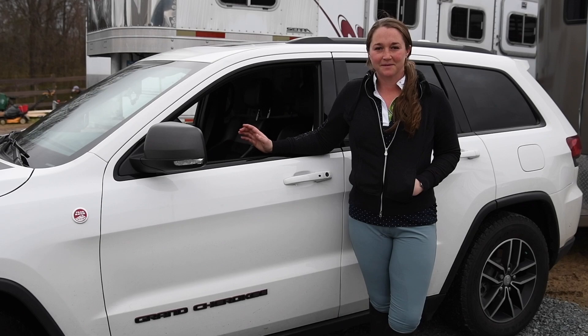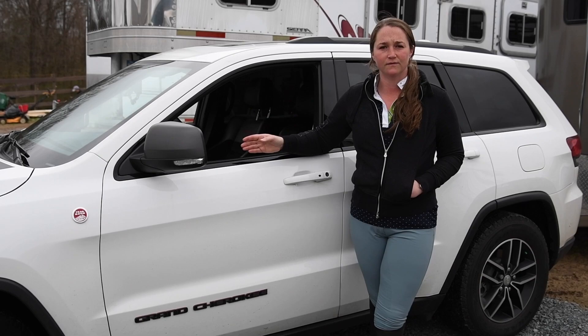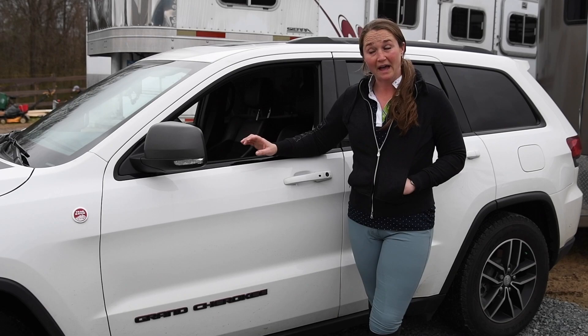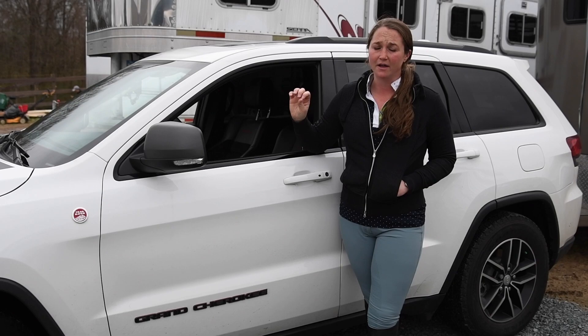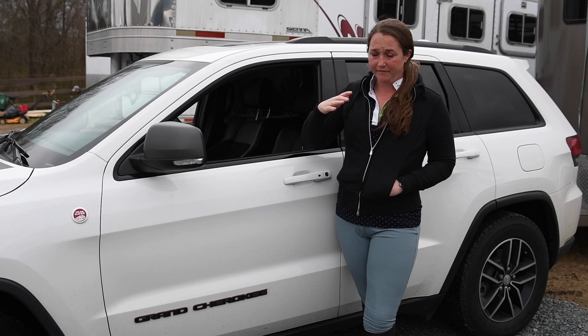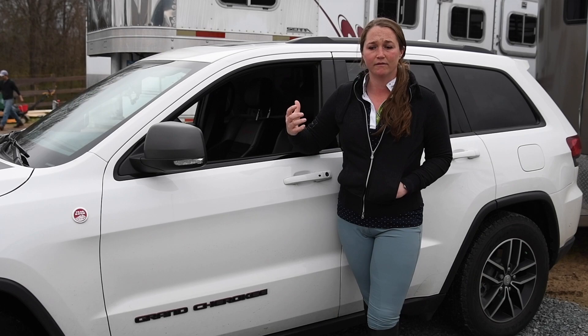I hope you guys got something out of seeing me hook up my horse trailer. Just remember that safety is extremely important, and when you're backing your horse trailer or just hauling your horse and going straight, try and go slow, take your turns very wide, take your time. Spend some time without a horse in the trailer getting acclimated to hooking everything up, driving it straight, and backing it without a horse so that you can take your time and not be rushed and not have to worry about what your horse is doing in the trailer. This is going to be a very valuable way to spend your time getting really good at hooking up, driving your trailer, and backing your trailer. Because you never know when you're going to need to take your horse somewhere, and when you add the element of stress of having to hook up your trailer by yourself if you're not familiar with doing that, it just makes things ten times worse.